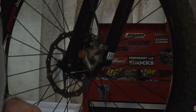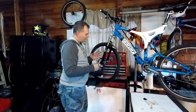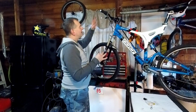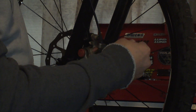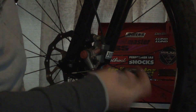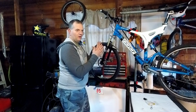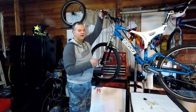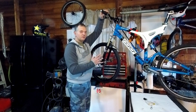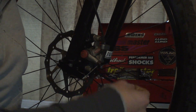I just adjusted that out and then we can check the lever. It's not centered — I have too much space between the pad and the rotor on this side and definitely too much on this side as well. So I want to center it up. It's a little cockeyed with new pads in there. I've already cracked these loose — loosen them up a little, back them off. There are two washers here and two washers here on either side; they're cupped so you can rock it all the way around and they'll fit. As soon as you tighten them up, you're good. So you want to hit the brake and hold it — this is similar to doing it on a hydraulic brake system. Tighten this up because right now you are centered on the rotor, and there you go.